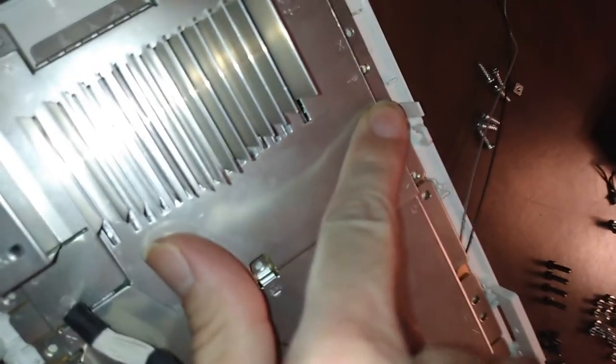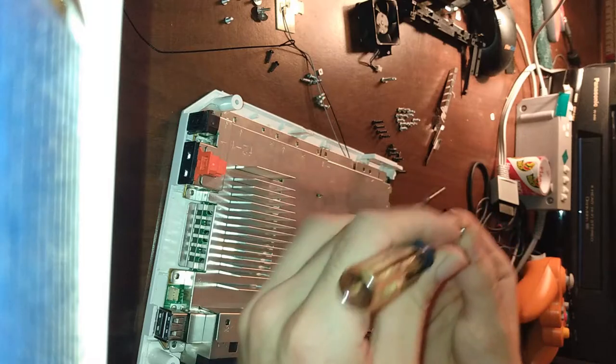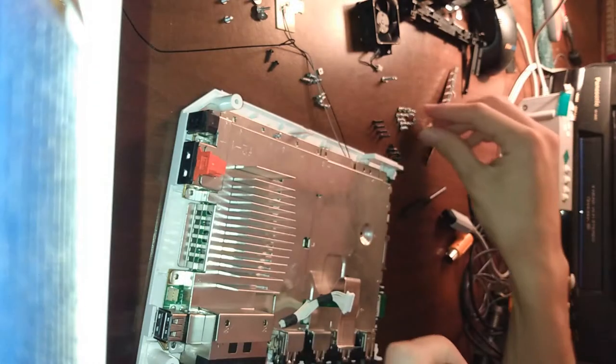There we go. One of the easiest things to help you in reassembling this is the shorthand on the shielding here. See an arrow? Go for the short screws. See an X? Don't put it in just yet. See the square? It probably needs something like this, or this. Now that we know the shorthand they were trying to use, putting all these in should be very easy to do.